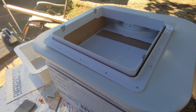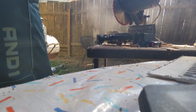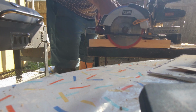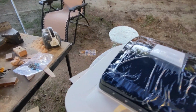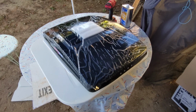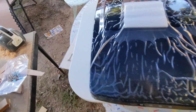This is one of those times where trimming the wood a bit will save a ton of headache as far as leaks. We trimmed the 2x4s further until we got the top trim piece flush against the exit hatch to minimize the risk for water leaks. This is what the finished product will look like. We'll be sitting flush up on the roof. Actually, if you're doing this kind of conversion and you want the emergency exit part to be on the back so that you can release this side, the whole thing will hinge up and you can still have access to the roof.